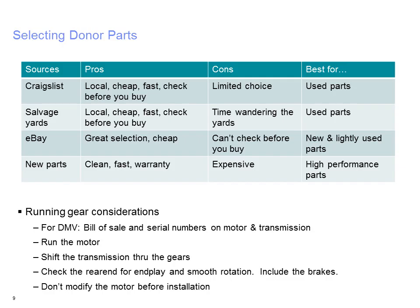One of the key things is theft. They want to make sure you're not putting a stolen engine or transmission or other running gear, major components, into the car. So they're very interested in things like the serial number that's stamped onto that block. And in some states, I understand they even look at transmissions and other components. So when you buy your components, first, don't buy them from any sort of dubious source, but also make sure that those serial numbers are very clearly marked on the block. And on some cars, particularly I can tell you for Fords, they actually have a problem sometimes with the serial numbers on there not being clear. They don't engrave them deep enough, so they literally wipe off.